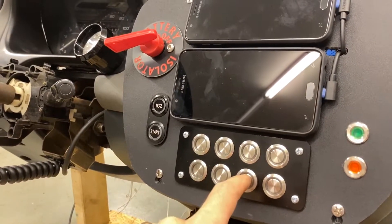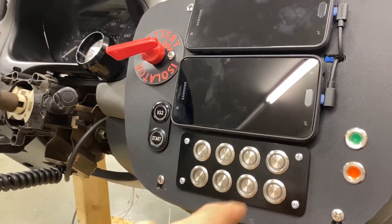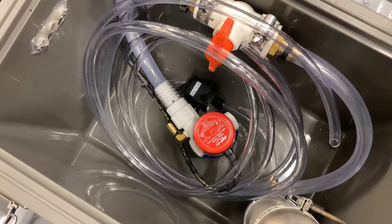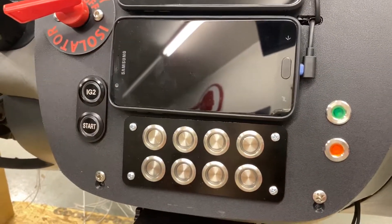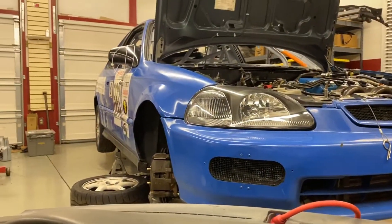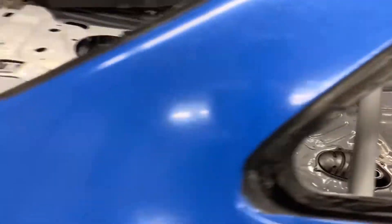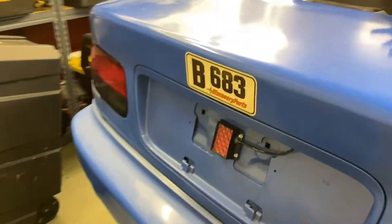This is for the cool suit pump — when we turn that on, that switch turns on that red pump. Remember that black little pump down there. This one here is the rain light — on the back of the car, that switch controls the ground via that harness, which won't be taped down when it's done, to this guy.